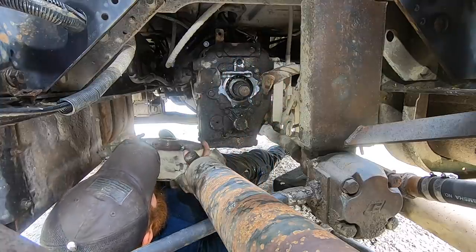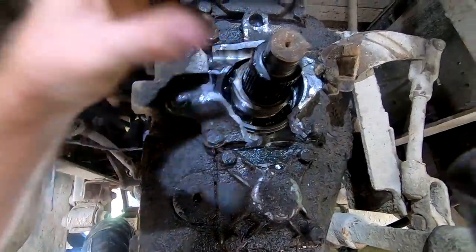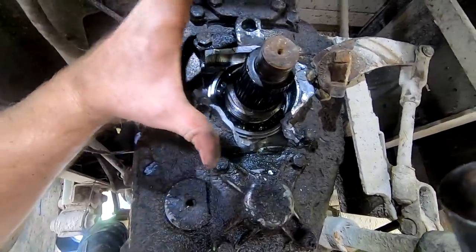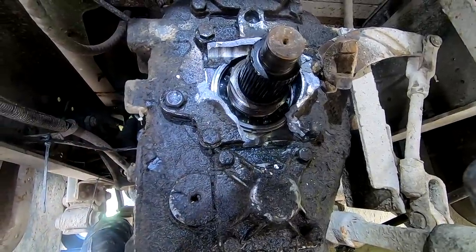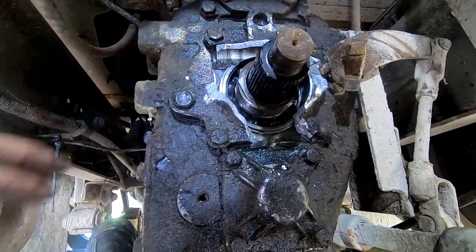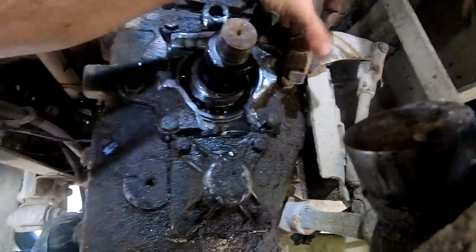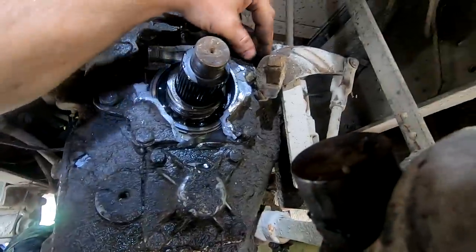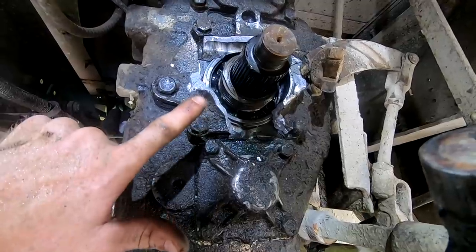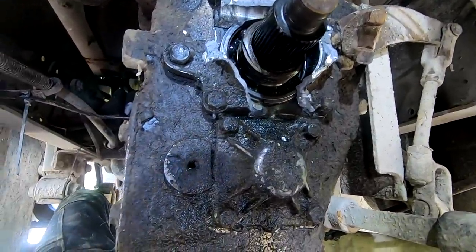Here's the inside — the parking brake was engaged and I bumped it into gear. It killed the engine by literally binding it and bending this whole thing up. And I think all that force just shattered this. The silver lining is I don't think we damaged anything but that middle housing. Maybe some of this parking brake mechanism might be bent — I'll need to figure that all out. And I'll need a new speedometer gear.